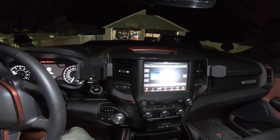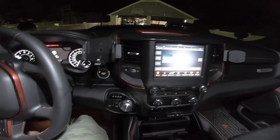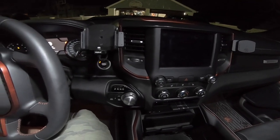The car is not drivable. Even with the stereo volume off, it's just the active noise canceling. You've got four microphones — I'll show you in the daylight — but those microphones need to be disconnected. I'm going to go underneath my driver's seat, unplug the four mic connections, and that should fix my problem.